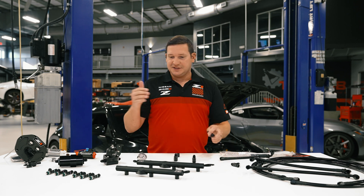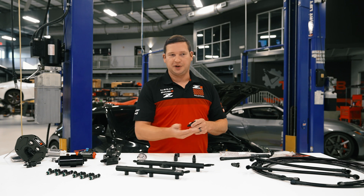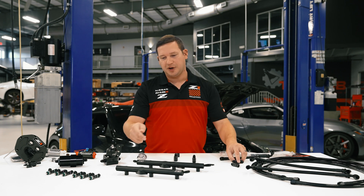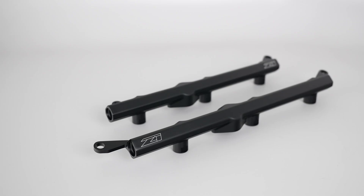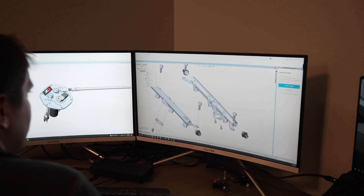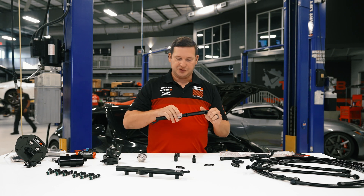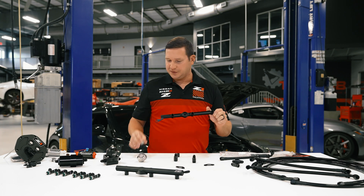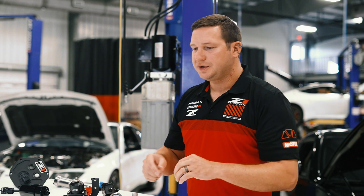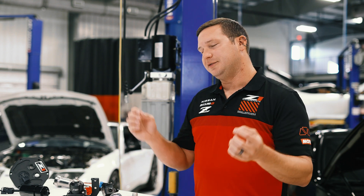Once we come up under the hood on this system, we're going to split the lines and run in parallel under the lower plenum — very sleek and hidden. We're going to come up and tag on to our fuel rails. These are 12 millimeter internal diameter, CNC, hard anodized rails. They feature a nice discreet provision to transfer your factory dampers, or you can add new ones. They attach with stainless steel hardware, so you've got maximum corrosion resistance inside and outside the rail, and it looks very nice.